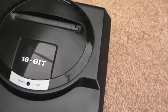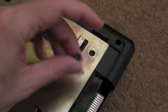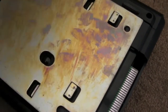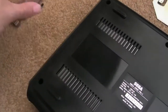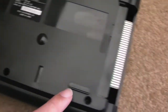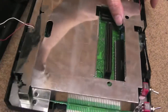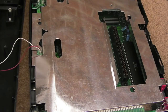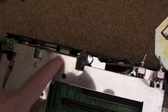If you've not been in the Mega Drive before - a standard Mega Drive on its own won't have this plate; I've just taken this screw out. This is the plate that holds up to the Sega CD. I'll slide it forward like that and then it comes off. There's a little thing stuck between the vents on the end that you can just prize off, and then there are six screws in various positions underneath. When you lift the lid up, be mindful of this connection here - that holds the power LED.